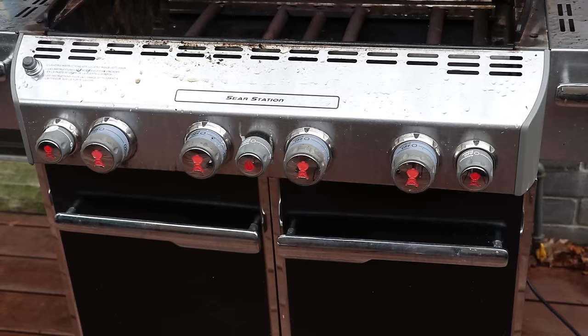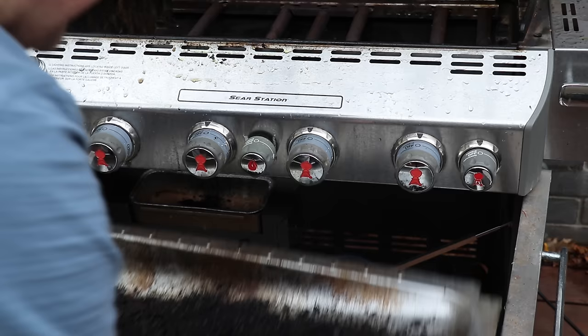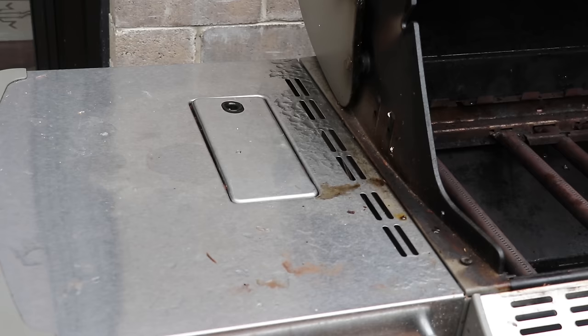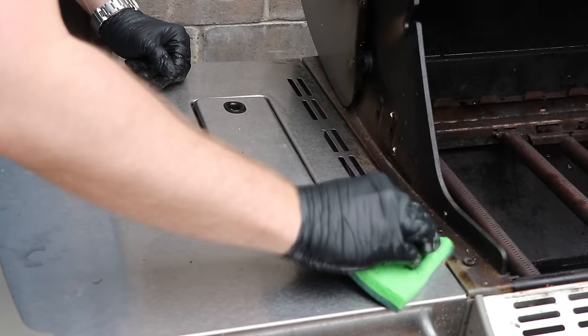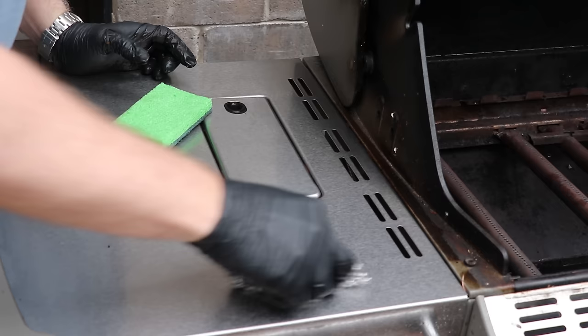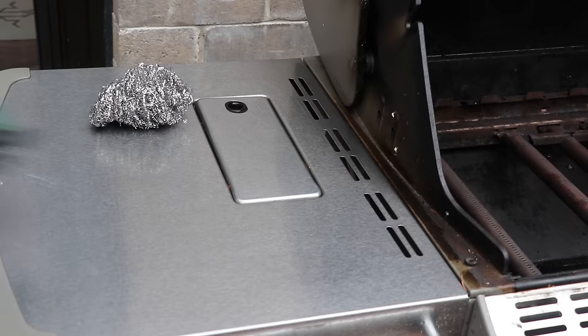With the interior cleaned out, loosen and pull out the grease tray — just look at all the junk that was in there. Empty it out and clean the tray itself. To get grime from the sides of the grill, take a scouring pad with a little soap and water and some elbow grease. For stuck-on spots, use a little steel wool — no problem, comes right off. Give it a rinse with cold water and it's done.